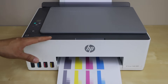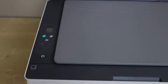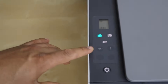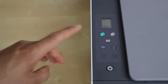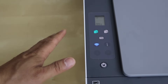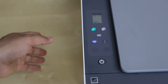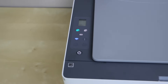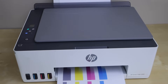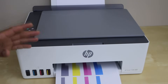Next, if you are using the printer over Wi-Fi, we can clearly see the Wi-Fi light is not showing up here. That means your printer is disconnected from the Wi-Fi and the Wi-Fi is switched off. If you press it once, it will blink for some time and reconnect to your wireless router. In case the wireless light is just flashing and not stable, that also means your printer is disconnected from the Wi-Fi network and you have to reconnect it.